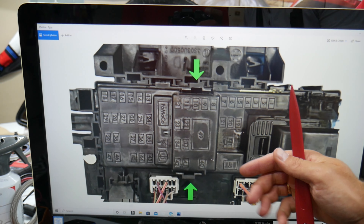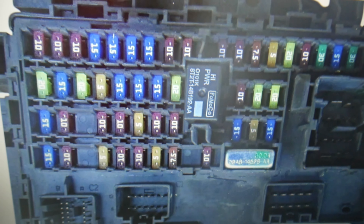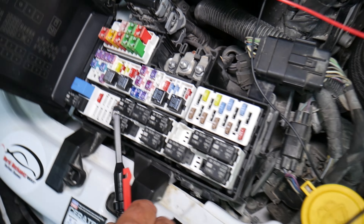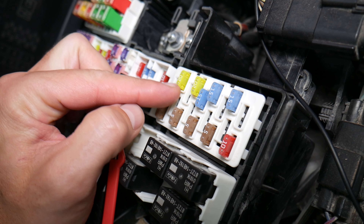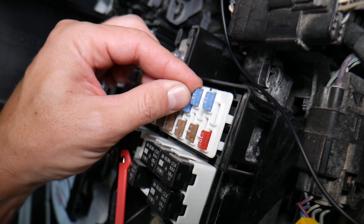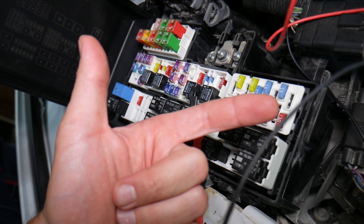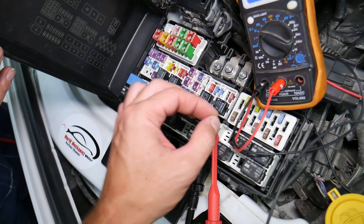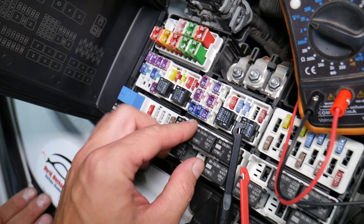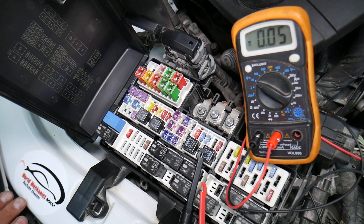Behind it you'll find a fuse box with a layout like this one. Before we continue, let's explain why it's always a good idea to test fuses and relays. Fuses — you can't always tell if they're burned or good just by looking. Sometimes they may seem perfectly fine, so you think it's a good fuse, put it back, and end up spending money and time on parts and problems that don't exist. Test your fuse, find out it's bad, replace it, and fix your problem. We'll have a video on how to test fuses and relays — we'll put the link in the description below.